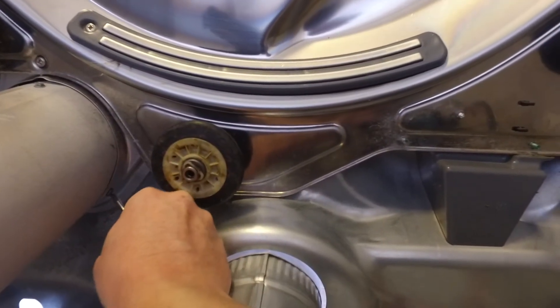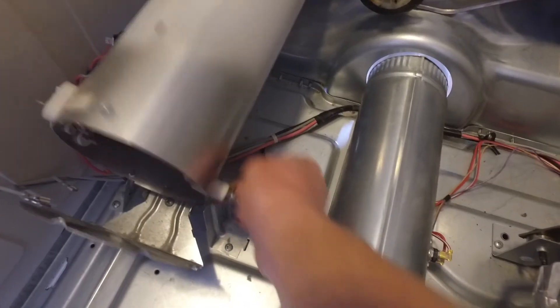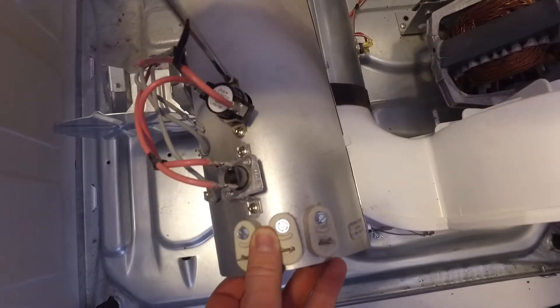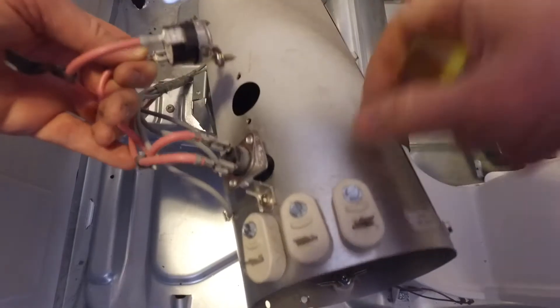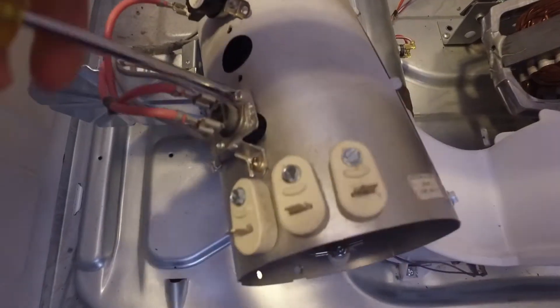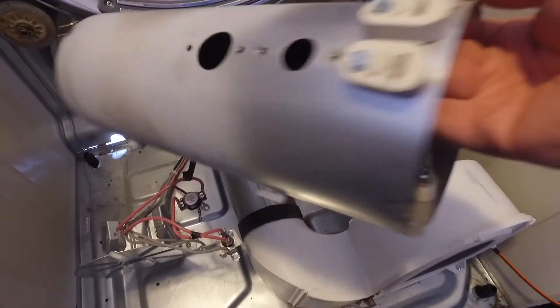I found the easiest thing to use on this is just a tiny screwdriver. If you have a fancy screwdriver that bends, you can do that as well. Notice the little wire I just took out — as soon as I took that wire piece off, I pulled it out. And then I just had to take these pieces off with the screwdriver. I unscrewed both parts, and then I was able to take the element out so we can put the new one back in.